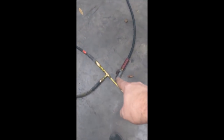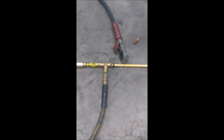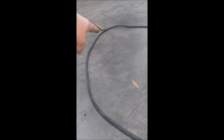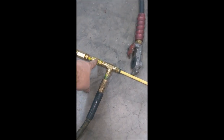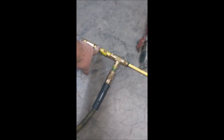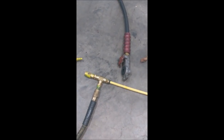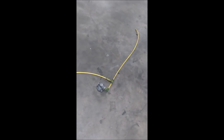If you follow this air line up, it goes to a T — and all these fittings on my truck are already pre-made and ready to go. The airline comes off the wrecker, goes to the T. You've got the yellow line that goes to the back to release the tractor brakes and air up the suspension, and then you've got an airline — supply your own red airline to release the trailer brakes. I've got a spring up there — that's how it would hang on the truck — and then you've got your glad hand. I've got a female quick connect on this end and a male on the red line, so if I get to my destination and have to separate the truck and trailer, I can just disconnect the airline from the trailer and still have the truck brakes released and the suspension up. That locks the trailer brakes down and you can separate it. This would be on your Freightliner Cascadias and your Western Stars.